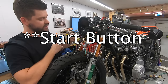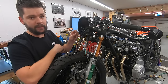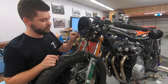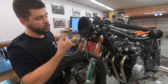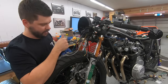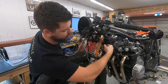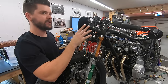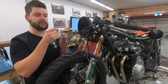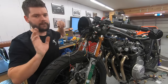Last connection on the right side is going to be our start button — this one's super simple. Two wires: one goes to common ground, the other is going to go to our start input on the M unit. That's literally it — it's grounding it when the button is pushed, otherwise it's disconnected. The horn is going to be super simple as well — basically the same setup we just talked about for the start button, with the added step that we need to actually run the power and stuff, the outputs to the horn itself. And then the turn signal is one that's pretty simple too, but I'll walk you through it because I want to utilize one of my diode kits so that we can retain the turn signal indicator light within the gauge.